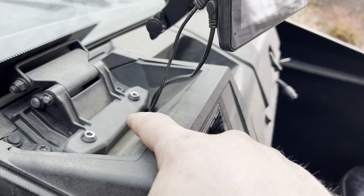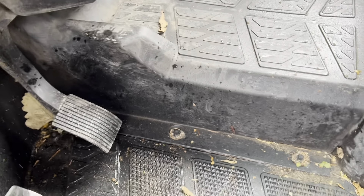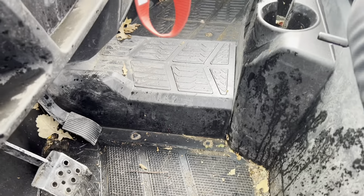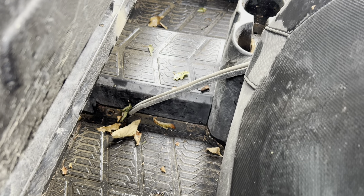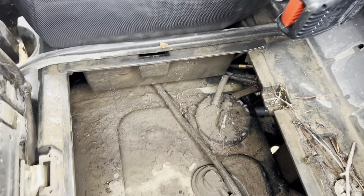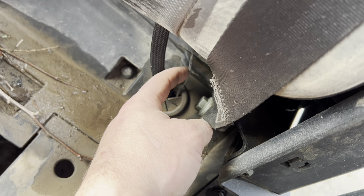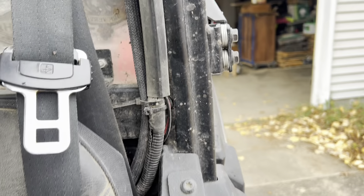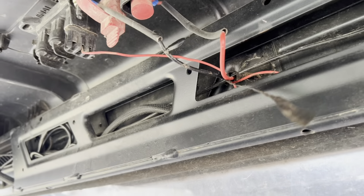To wire this up — two wires, a power wire and a camera wire — I drilled a small hole in the back and ran it down into the dash. It drops all the way down and runs underneath that floor plate. In the middle hump there are three plastic quick pins that hold it in place. Take that cover off and underneath there are plastic wire hold-downs. Same thing on this side — I think there are four clip pins. Pull those out, the center piece comes out, run the wire underneath. Then I drilled a hole and put a cork in the corner — the camera wire runs up through there with a wire loom that goes off this edge and is tucked behind everything back there.